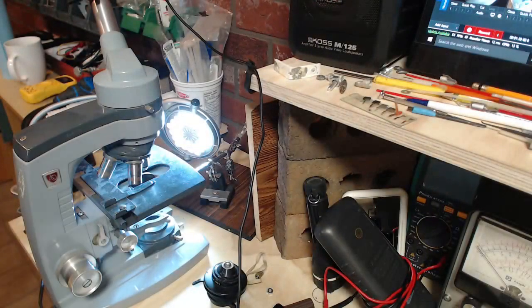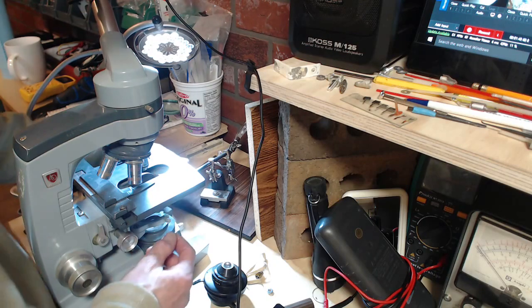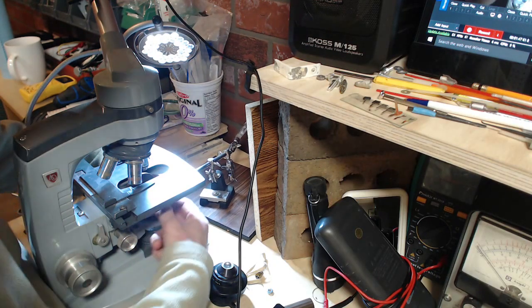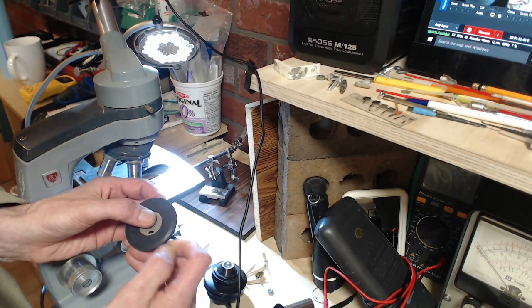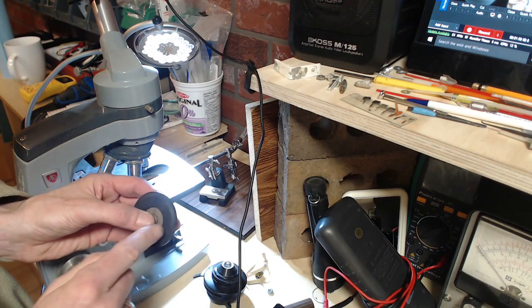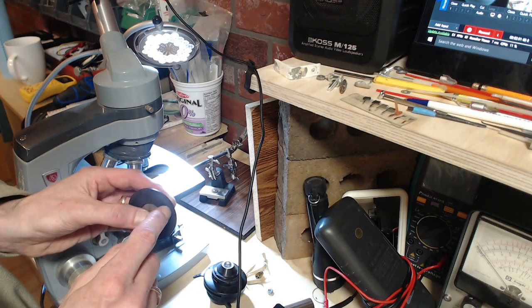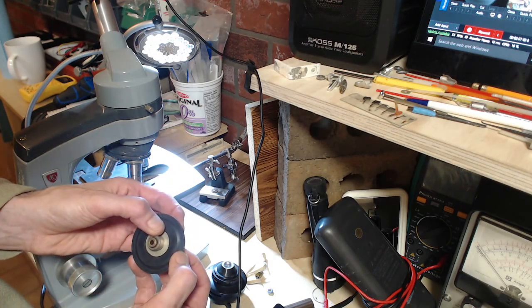And I hadn't looked at many under the microscope, so really look at one that's really deteriorated. The last one I did just a couple of days ago, the wheel, intermediate wheel, was clearly oxidized or something had happened on the surface. You could feel it was extra hard, the rubber behind it. Like you can stick your nail into these things and kind of judge the hardness a little bit, and then you can compare it to the rubber in behind here. Again, sticking your nail, looking at how easily it flexes. This one is really flexible.